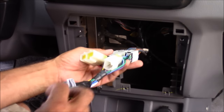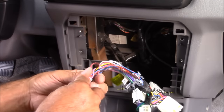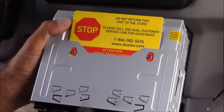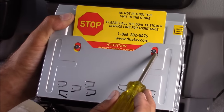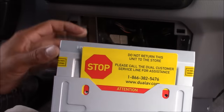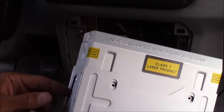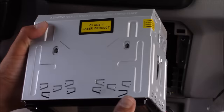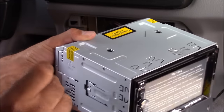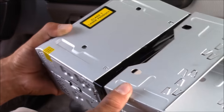Now that all my wire splicing is complete, I'm going to plug my battery back in and test the car stereo to make sure everything works before going any further. A lot of car stereos that have a DVD or CD player will have screws that secure the drive into place — you simply have to remove those screws before you install it. Most aftermarket stereos also have a mounting cage that allows you to mount the stereo easily; you loosen the tabs on each side and it pops right off.